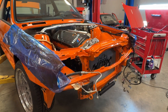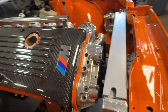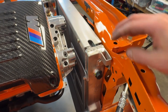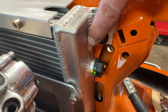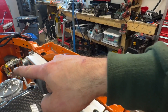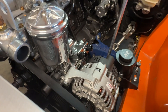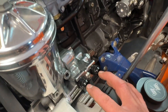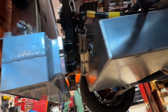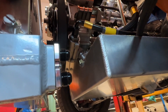So we got the radiator installed — I know I skipped a couple of steps but I'll show you what I did. We did get some blue protective tape on the top surfaces just to make sure we're not marring any surfaces. This guy here is installed with a couple of M6 bolts now on the top side — I welded a couple of aluminum brackets on there, one on each side. Now the next thing we're going to do is the oil cooler lines. These are AN10 lines — this is a pair here — and that goes to this pair here. The 90 degrees does not interfere with the oil pan.